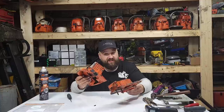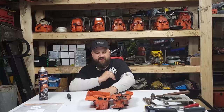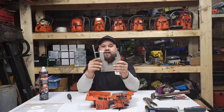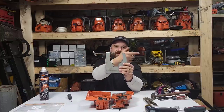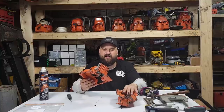This one on the other hand is kind of ugly — you guys have seen this. We broke down the cases on video and I haven't really been back into it. I've been getting lots of questions on bottom ends, friends — the dreaded bottom end. I get emails all the time. A fella emailed me two or three days ago — I believe it was John — and he said, 'Tin Man, once I split the case with my case splitter...' Now remember friends, you need one of these if you're going to do bottom ends — you should buy one. This pushes the end of the crankshaft through the bearings, holds the bearing on this side, and pushes the crankshaft out of the bearing. But I get emails all the time: what do I do after I get the crankshaft out — the bearings are still stuck in there?